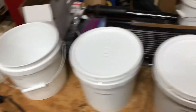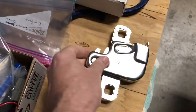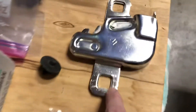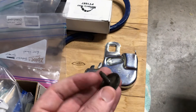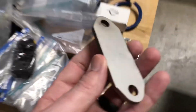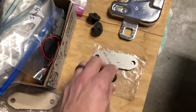I'll also need some extension cords, copper wire, and a stick to lay across to hang the items on. So what I'm doing today: I had previously plated the hood latch, which came out really great, but I missed the bolts for it. These bolts have big fender washers and little nibs on the bottom that dig into the bracket — they're a specialty part, not easy to find, so I'm going to re-plate them rather than replace them. I'm also plating my EGR block-off plate, which I missed before, and the nuts to hold that on.